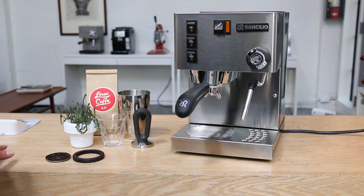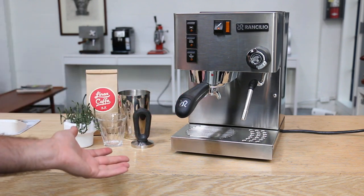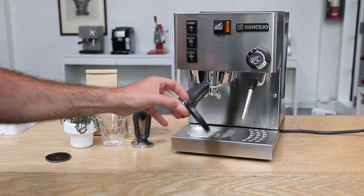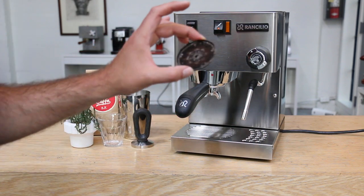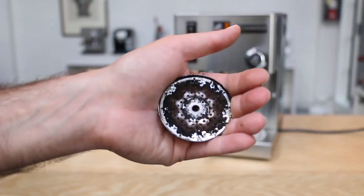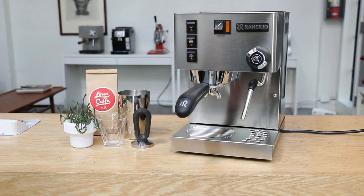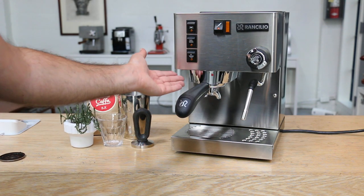The main complaint here was clear water dripping around the group head. The reason this is happening is because either the group head gasket — the one that sits over here — or, as you can see, this is after I cleaned it a little bit, the screen. When it gets clogged with old coffee it creates a lot of pressure, it's not sitting right, and it leaks.